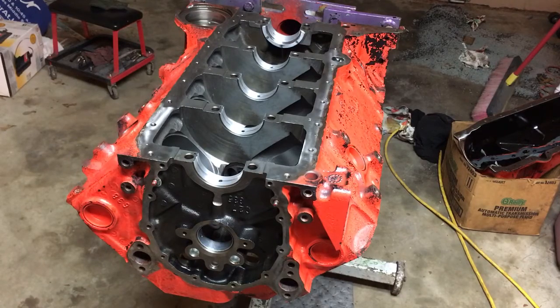So basically to remedy that, I swapped out the purple high pressure spring, because apparently that high volume oil pump has a much higher pressure spring. I had done some research and found online where you can substitute that purple spring in that high volume pump with the yellow standard pressure spring, and it's going to put me back in the range that a normal engine would want to see under cold start and fully warmed operating oil pressures.